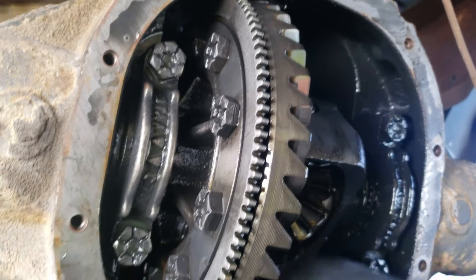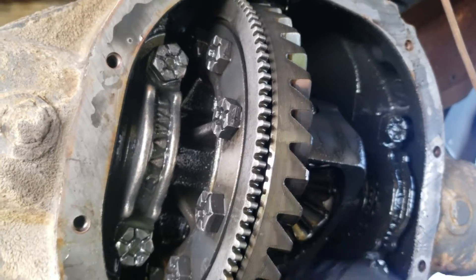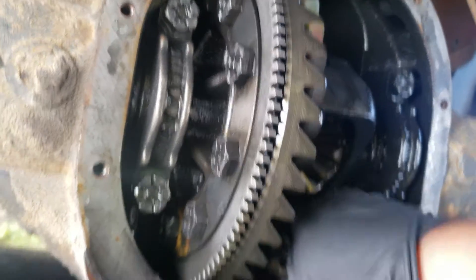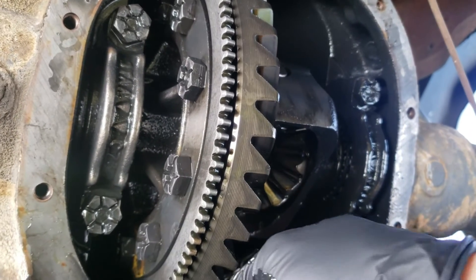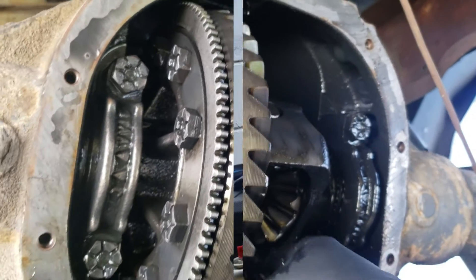On the bottom of the truck, get as much of the old RTV out as possible. I wouldn't recommend using brake cleaner in here because of the bearings — just try to get it as clean as possible by hand. Use a normal cloth or tissue and get your hand in there to get all the old oil out.